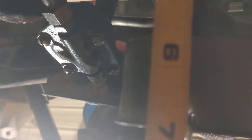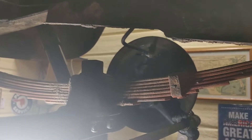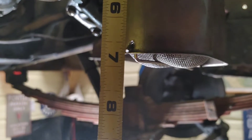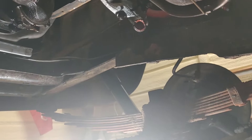The pickup screen is six and three-quarter inches, and the pan is seven and a half inches deep, not counting the gasket. That leaves you a measurement of how much sludge can build up before it gets sucked up. There's quite a bit in there, but it seems to be okay.